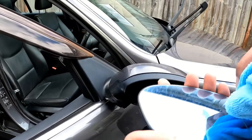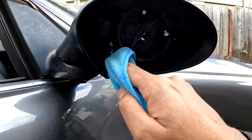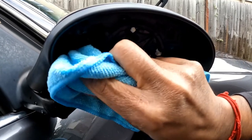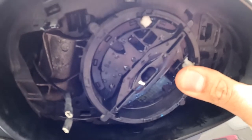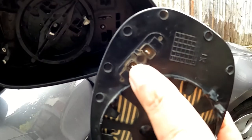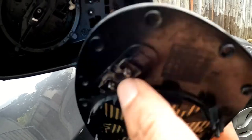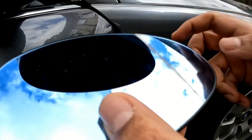I've given this wing mirror a good clean. Now I'm just going to clean the surface on the inside — you don't need to, but it just makes it look much better. I gave the car a good wash as well. Now you want to make sure that this one is centered. You will have these two little prongs here — this one is for your heated mirror. If you do not have a heated mirror, you will not have this line here. This is your mirror heating element.